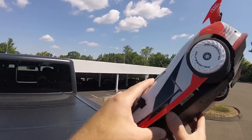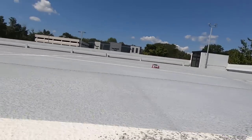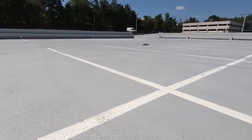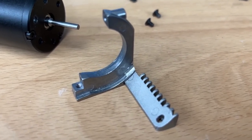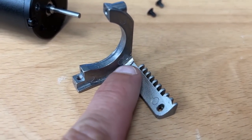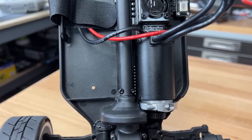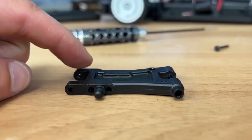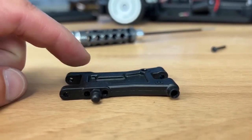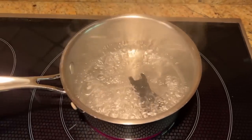I wound up having a really good time driving the car, however there's some stuff to talk about. I had some fixes to do before I even went out and tried it. Let's start with the motor that was on the angle — after some diagnosing I found out there's a little piece of metal on the motor mount itself that was hanging up against the motor plate. I just ground that piece off and it allowed me to straighten the motor out to where it needed to be. The other thing was what I thought was chassis tweak — it turns out the rear suspension arm was twisted, so when I pulled up the car that's why the one wheel was coming up.